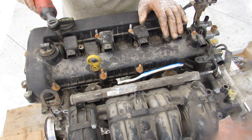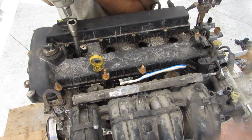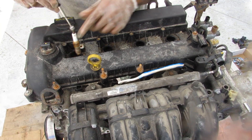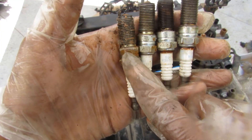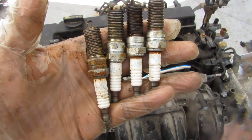I'm going to start this teardown by removing the ignition coils — these all look pretty dry. Now I'm going to pull spark plugs to see what's inside this engine. Whoa, this is rusty and milky. So if I'm going to guess, cylinder one probably had a compression issue or the head gasket on that side is blown.